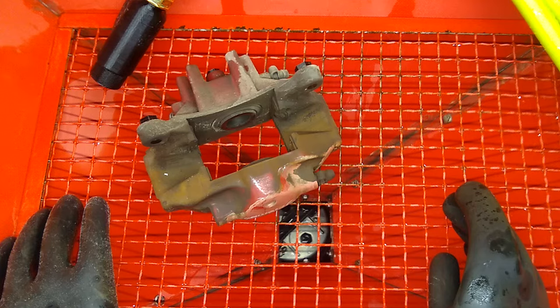Spotless, brand new. Next up is the 36 grit garnet, and we'll be blasting at 50 PSI using the version 3 nozzle with an 8mm tip. We'll see what it does with the big media. Visibility is probably going to be lousy.